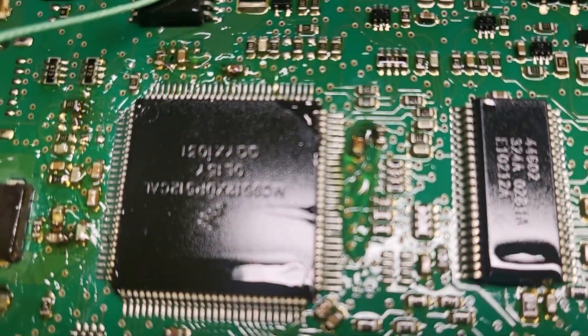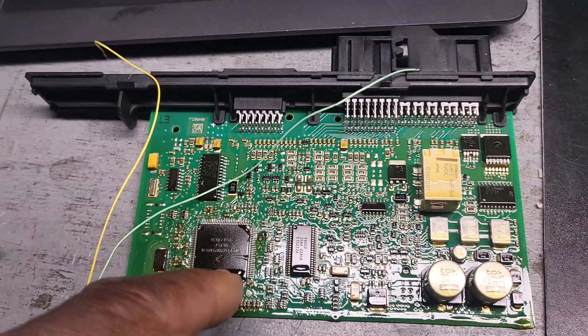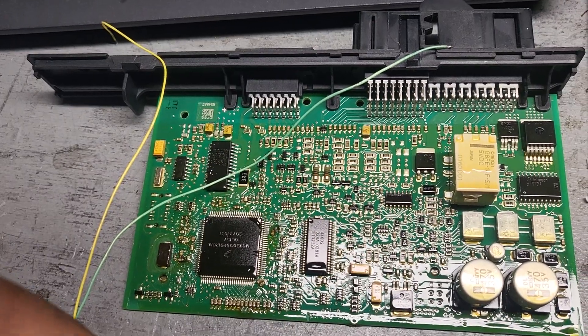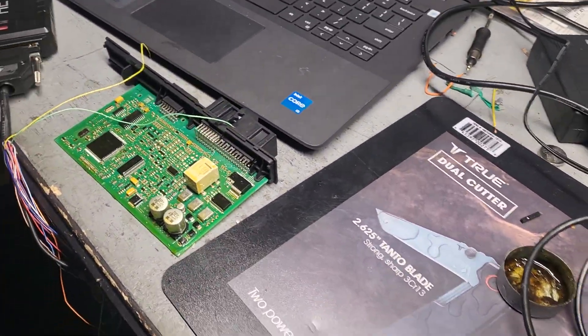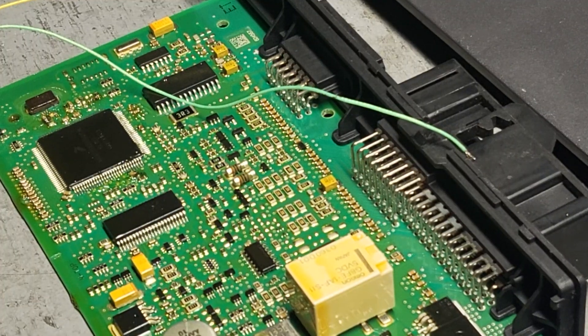On the bench last time I was able to read — you see this one, zero L one five Y — I was able to save the EEPROM file and the flash file. So I'm going to try to load it again and see if we can do something.